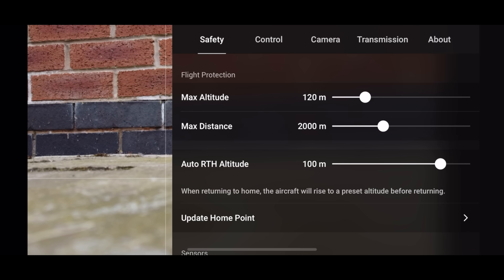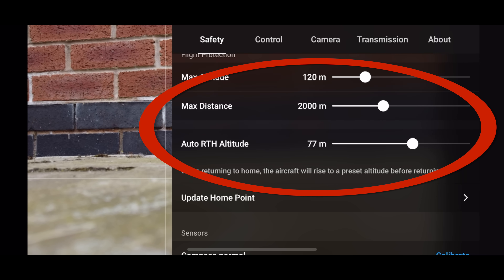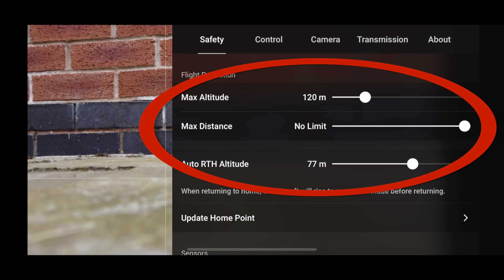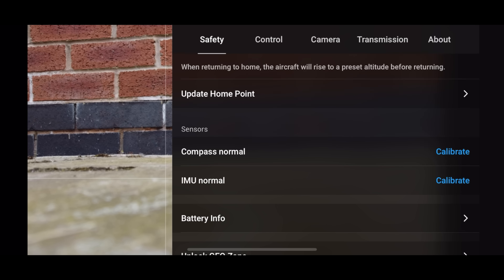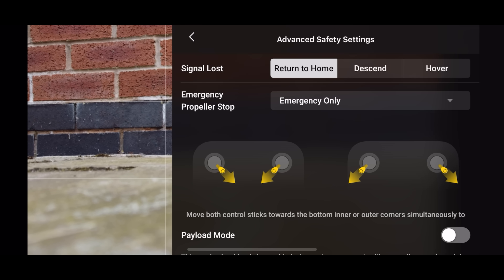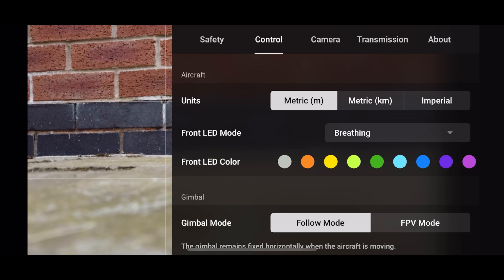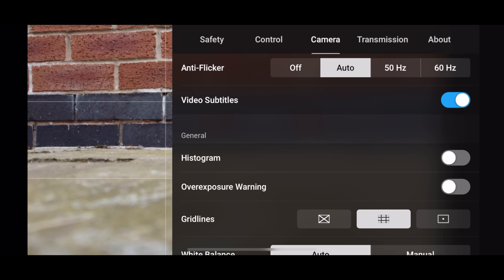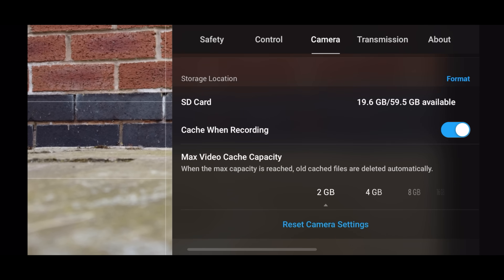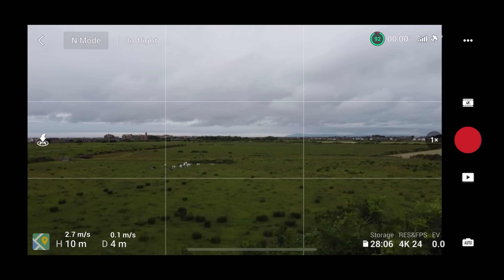Of note: when you are updating any firmware on the DJI Mini 2, just check all your main safety values. Most of the time, just like mine, they have been reset — and it tends to do this a lot on firmware updates. Make sure especially your return-to-home altitude is not too low or too high, and the same regards to your altitude and distance limits. Whatever your normal values are, go through before setting off and make sure your safety settings are all as you want them. Don't be up in the air and then realize you haven't changed something.